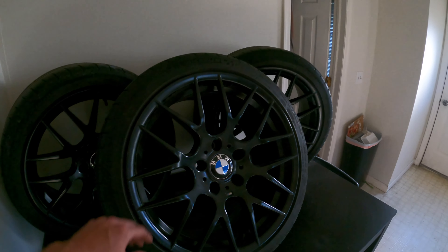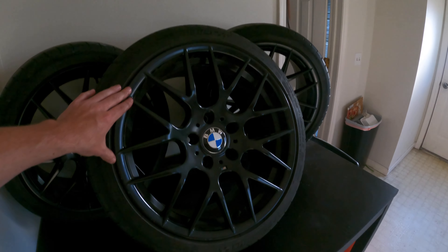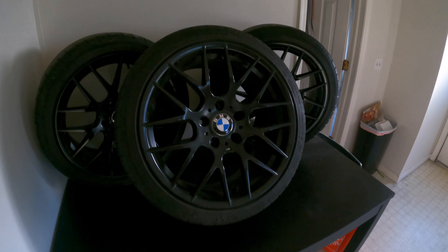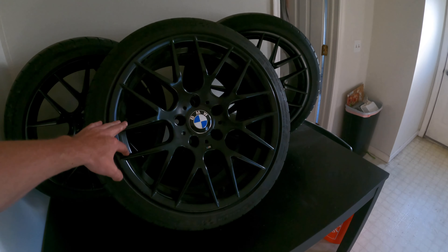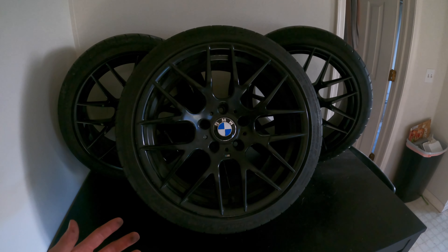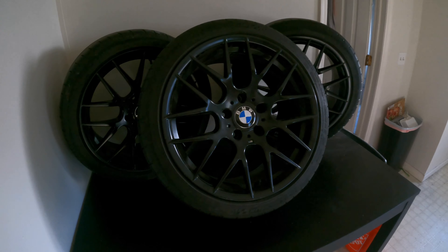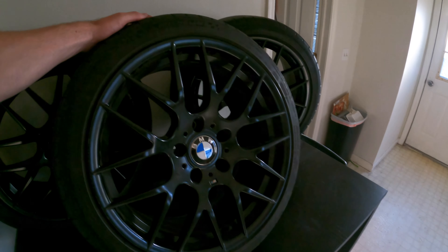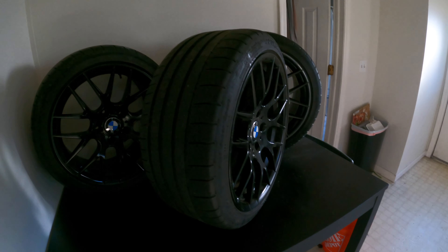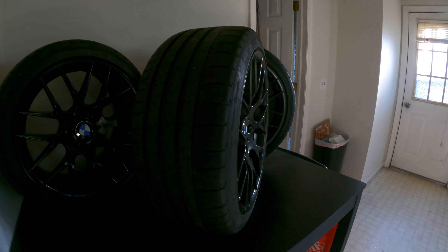To tell you a little bit more about this wheel and tire setup — these rims are Avant-Garde M359 replica wheels. These are replicas of the same style of wheel that BMW offered on the competition package M3 for the E90 and E92 M3s. The one difference is the BMW rims that came on the competition M3s are 19s, whereas I have 18s. You can get the same wheel in a 19 from Avant-Garde aftermarket, but I went with the 18s. I live in a city — having a little more tire sidewall and a smaller rim really helps with ride quality, and the 18s still look really, really good on the E92s. I forget exactly what the offset is, but I think it's negative 34 — I could be totally wrong, so don't quote me. The concave on the offset is really, really nice.